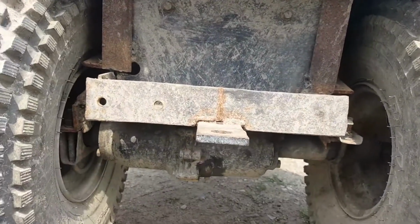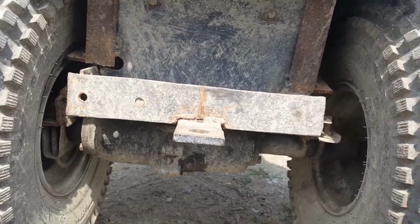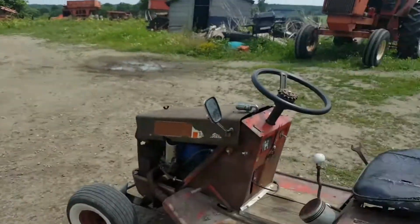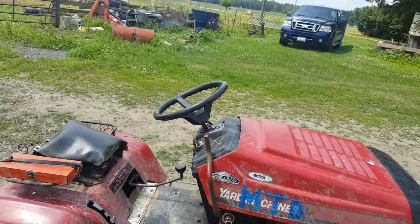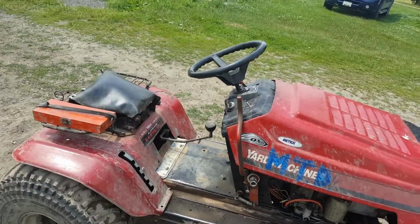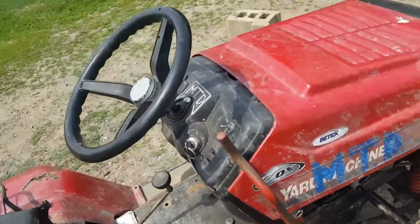I think this is actually a 601, which is a Peerless 600 slow speed. But the only difference in terms of speed, I think, is the pulley size. This one, when I bought it, had a huge pulley on the transaxle, it was like gigantic. So that's probably why it was such a slow transaxle. It would have been nice for certain applications, but I obviously have the original transaxle pulley. I just had to make an adapter because the MTD FNR input shaft was splined, and this one is keyed like everybody else.